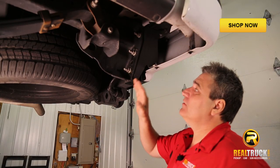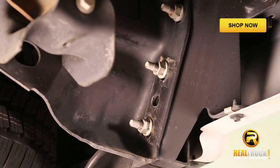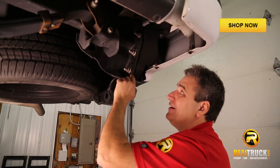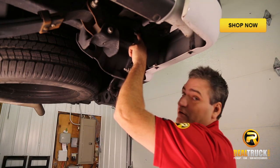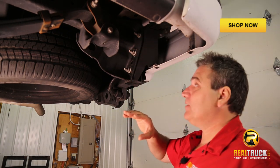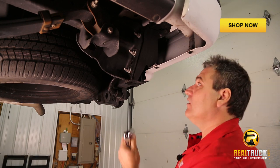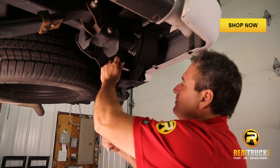Now we're under our truck. If you look up inside here by the frame, you can see these three bolts sticking through here from your bumper and your hitch. What we're going to do is remove the bottom two. Leave this one in here because if you take this one off, your bumper hitch is going to drop on you. The slide step only requires that you remove these two. They're usually pretty tight from the factory, so we'll need a breaker bar to break these loose.